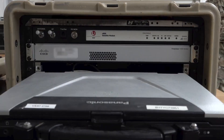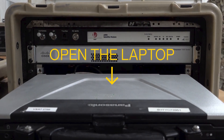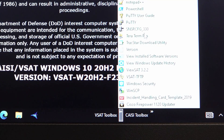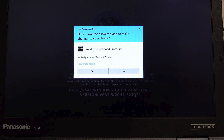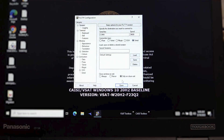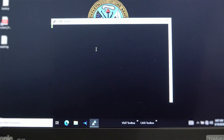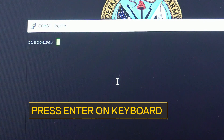Now, let's get the information for the SDN registration worksheet. Using the management laptop, go to the VSAT toolbox and select Putty. Click the serial radio button and click Open. Once Putty is initiated, press the Enter button for the Cisco ASA prompt.